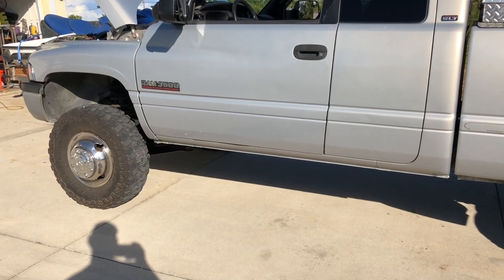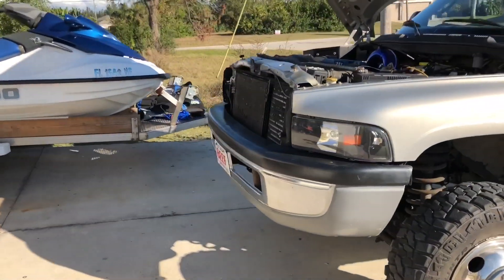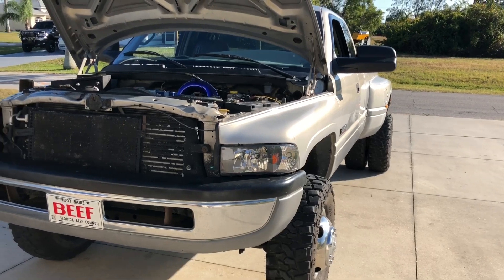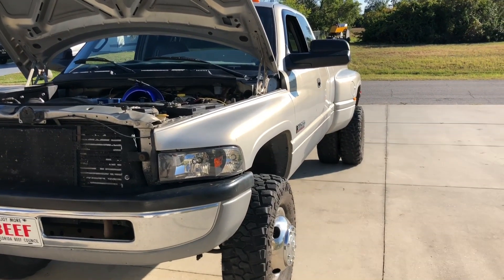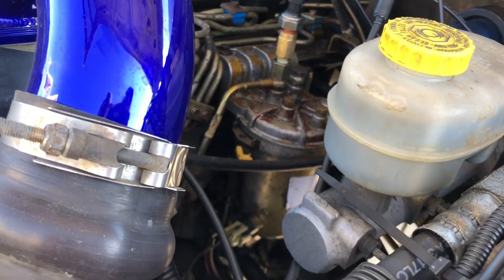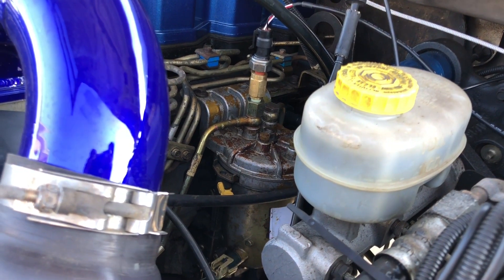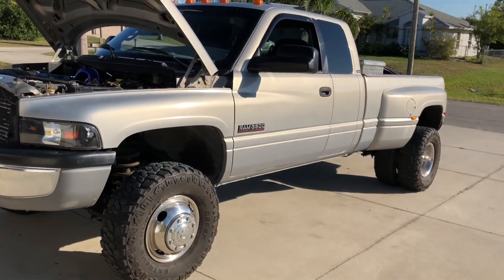That's pretty much all I got to say. I really could have used this video when I was doing mine, so I really hope this helps somebody. I do plan on getting an actual FASS 150 in the future, but right now I just can't put the money out for it. I may run this till the pump dies — I might even throw another one on there. It's only $120 and two wires and two hose clamps, so it's really affordable to get your fuel pressure up. The only thing you're missing is the water separator, but you're still utilizing your factory filter, so keep up with your filters. It's not going to be as good as a FASS by any means, but it's better than no lift pump and a bad VP. Hope you guys enjoyed — like, share, comment, subscribe. Thanks for watching!